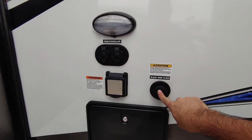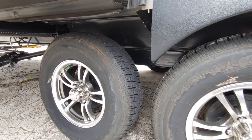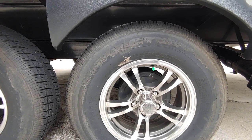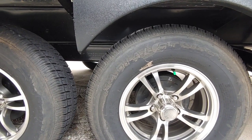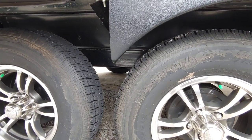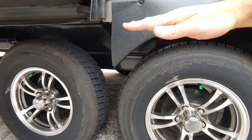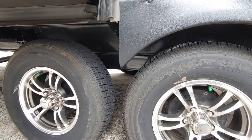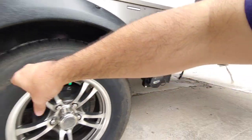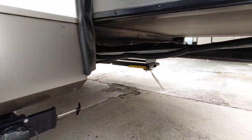You have your outside shower and a 50-amp connection, which means this probably has twin air conditioning units. Cable and satellite connection and your black tank flush. Coming down here, this rides on torsion axles — really cool and unexpected. The tires are Castle Rock tires; they'll probably last you a couple thousand miles. But the torsion suspension I'm definitely a fan of. It also utilizes an 8-inch I-beam frame with a spacer beneath it for the torsion axles, to lift the unit up for easier leveling with modern taller trucks. You have your sewer connections, and both slides — front and rear — are rack and pinion.